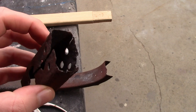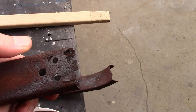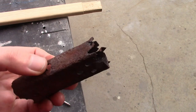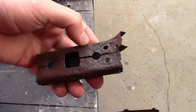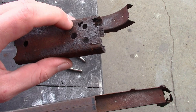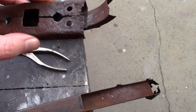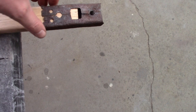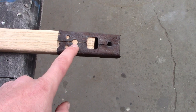After a lot of thinking, I've decided I'm just going to weld this piece back on and leave it, because it would be really difficult to make one of these and have it come out right, especially with all the holes and everything. From here back it's fine, so structurally it'll hold. I did consider just trimming the bad parts out and welding patches in, but the problem with that is I won't be able to dress off the weld from the inside, so I'd have to notch out the bow to clear it, and I don't want to do that. The bolt that goes through here is going to hold it pretty good, and what I think I'm going to do is either make a new bow or extend the ends so it goes all the way out and reaches the other bolt. I'll do the same thing for the other side, and that'll make it more than strong enough.